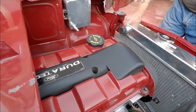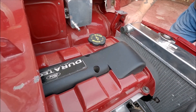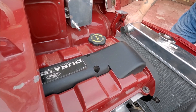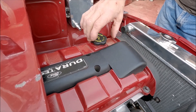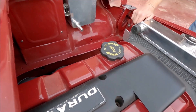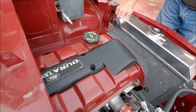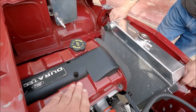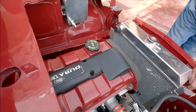I've changed the oil filler because it would have been too far up the back — I couldn't get anything in at the back of the rocker box. The rocker boxes on these are magnesium, so you can't weld them because they just catch fire. What I've done is cut it out neat and used Araldite — it ain't going anywhere and it looks right. We're going to have it powder coated because you can't simply get a nice finish on them otherwise.